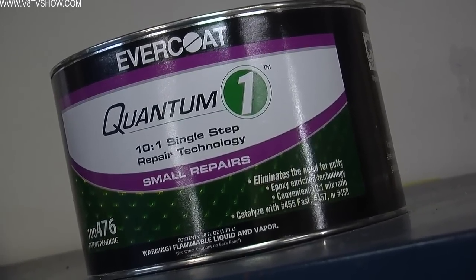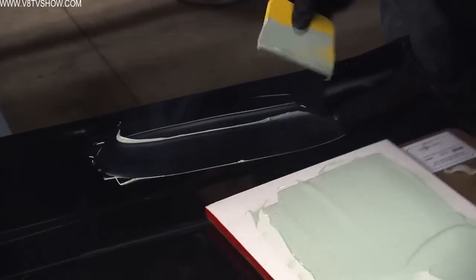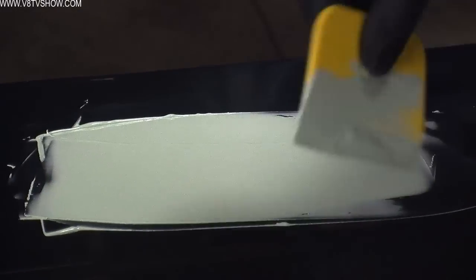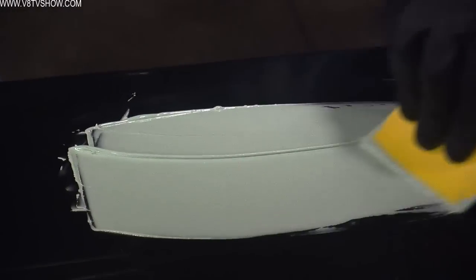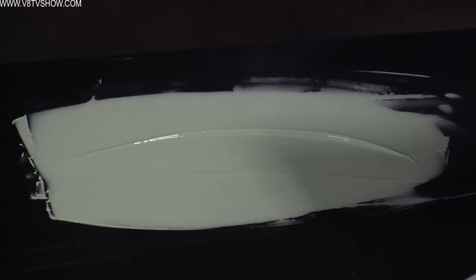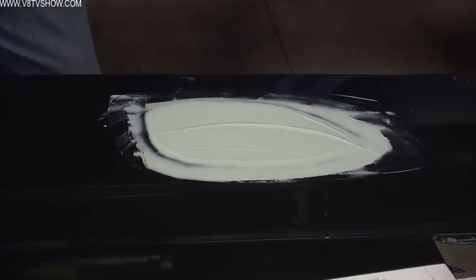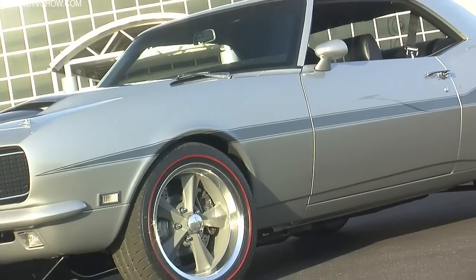That's what's nice about the Quantum One filler — with its much smaller particle size it doesn't absorb so much moisture, which can come back as sanding scratches later. Now, there are some times when you can use body filler over an existing paint job if you're just going to fill a little ding or a small dent. The Quantum One is designed to go right over this kind of stuff — you just have to make sure you feather the perimeter edge properly. Otherwise, when you prime and paint it you might see what's called mapping: it looks like a map, with an island in the color with a tiny ridge, because where the filler, primer, and existing paint all came together something shrank and it becomes visible in your final color.